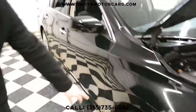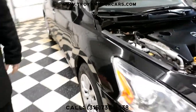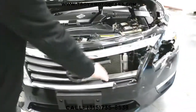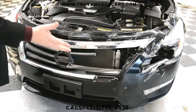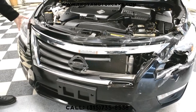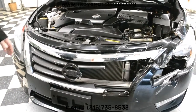Our primary damage here — we've got a little bit of scuffing here in this fender. That would really be the only thing on this fender, though no problem. So our hit here is a little bit to the left side, high. Our main reinforcement bar is right here, and I can see the frame horn coming forward. That all looks square, so I don't think you have any lower frame rail damage at all. This headlight — I think one of the tabs is broken; it's just a little bit loose in there. You could probably use it in a pinch.